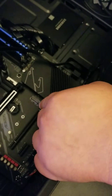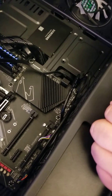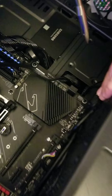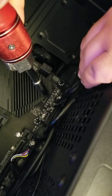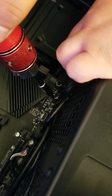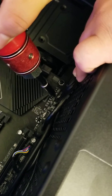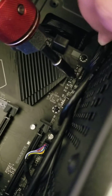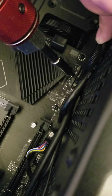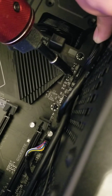One method is taking out the battery, and the second method is to short it. Using a screwdriver — and usually for this motherboard the little circuit is right over here above your pin — you just grab a screwdriver and hold it there for at least 20 to 30 seconds. I like to hold it a bit longer, but this ensures a hard reset. Your stuff will work.